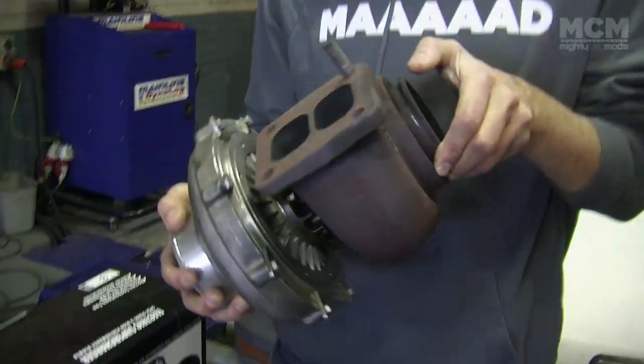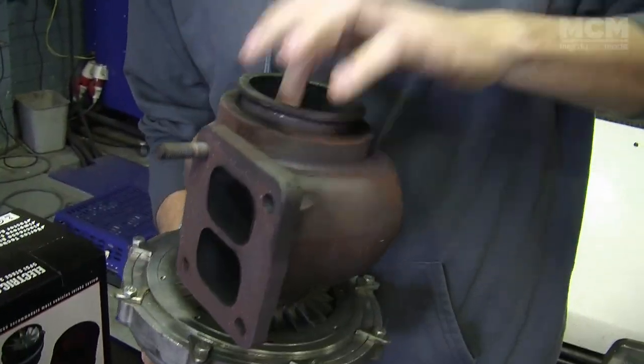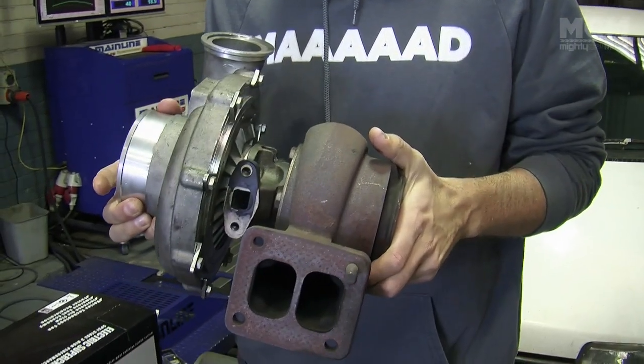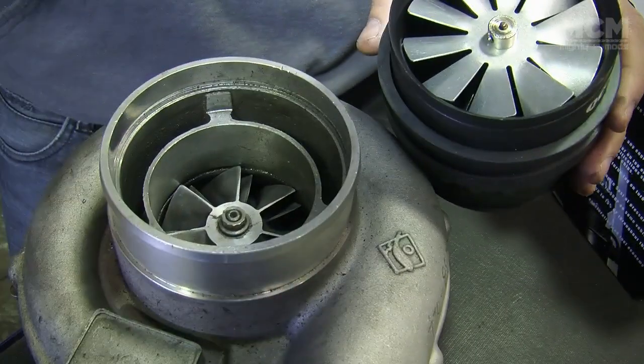Okay, so this is a conventional exhaust-driven supercharger. Turbocharger, because it's got a turbine on the back of it. The exhaust goes through there, spins the wheel, which spins the compressor and makes boost pressure through here. This is a particularly big and awesome one. Now that turbo itself is going to cost you well over $1,000. By the time you put it on a car, you're probably looking at over 10 with all the stuff to make it work properly. So it's quite incredible that for $300 you can get something that does the exact same thing. I'll show you how they work.